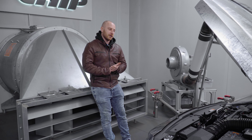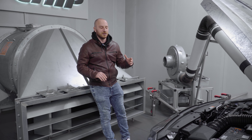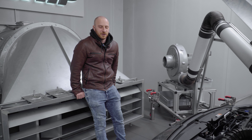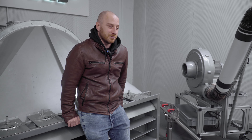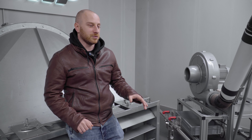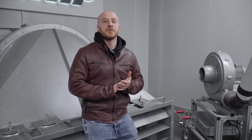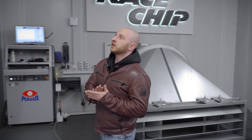For the tuning of the i20N, I'd like to mention first that this engine — 1.6L and 150 kilowatts, so 204 horsepower — is already known across the Hyundai-Kia brands. However, in the i20N the engine is completely new. The technology is called Smartstream, and that's the reason we need new plugs, because there are different sensors compared to the predecessor and the already known 1.6 — this one is brand new.